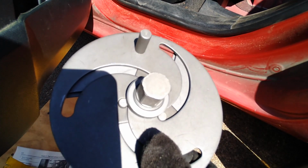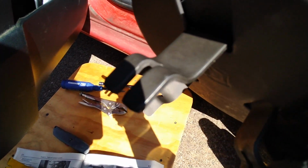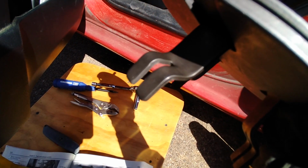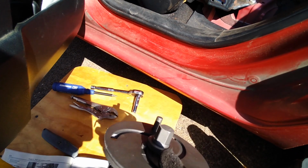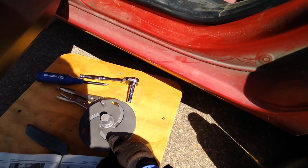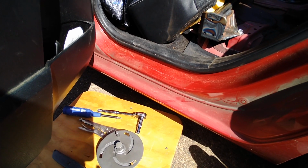But yeah, the size will be unique per the lock ring tool, and this little cleft bit sits on the shoulder of the lock ring where the rib is, and it just grabs onto that rib. Since they're cheap plastic parts that have aged a good bit, if you just take a hammer and a screwdriver to that lock ring, you're probably going to break it.